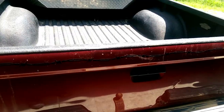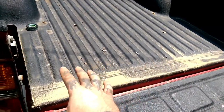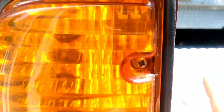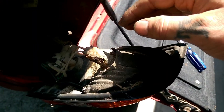Next you want to come to your tailgate and let your tailgate down. Once you get your tailgate down, it gives you room to pull out your tail light better. You have four bolts in your tail light — one here, here, and two on this side — and four bolts exactly on that side too.